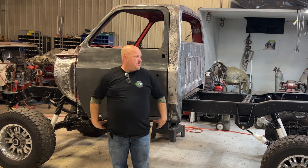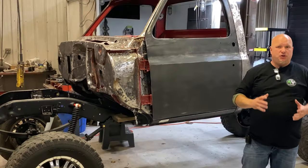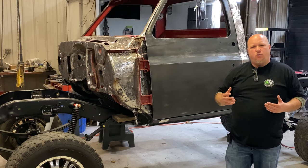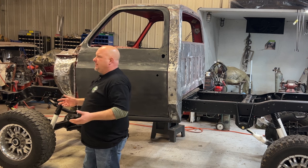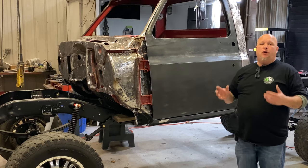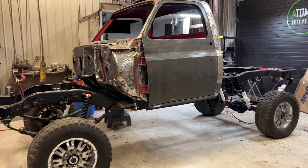What we ended up doing is sandblasting the bottom. We stripped down the frame, all of the parts, all of the hangers and things that hold the fuel cell up — all that got sandblasted, epoxy primed, and then we put everything in a stone guard. We chose the stone guard because it's like a satiny flat black. I personally feel it looks a little higher quality — it looks like something an OE would do. We do paint frames shiny, but when you paint a frame shiny you have to bodywork it perfectly, otherwise you'll have a shiny mess showing every imperfection. This is a great way to keep it looking OE and have it super durable. Between the epoxy primer that seals it as a rust inhibitor and the stone guard, this thing is like bulletproof — it's going to outlive us.